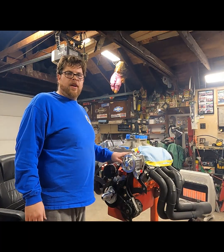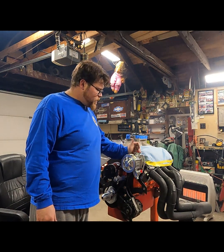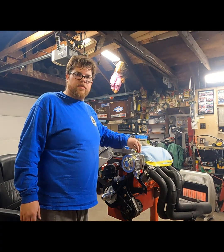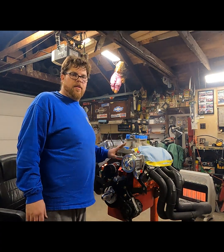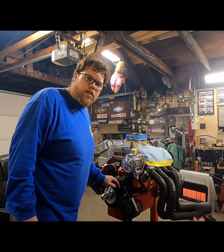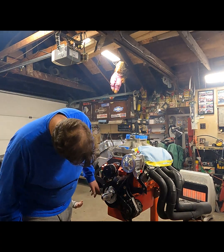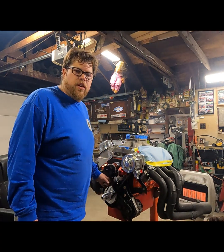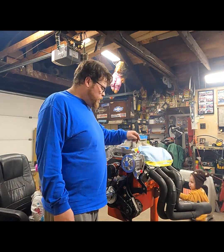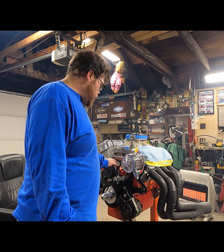Like I said, it's been a long drawn-out process. If you look up the Aeromotive website, the woman that drives the dragster sponsored by Aeromotive has it mounted up on the cylinder head just like this, so I went ahead and went with it. I know it looks close down by the water pump region, but it's not — we've got about a half inch of space between the belt and the water pump. We did have to make a custom little shim bracket to space it off the block a little bit more due to the style of water pump I have, but not a big deal.